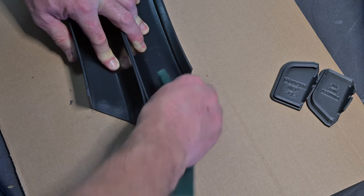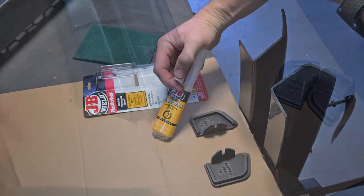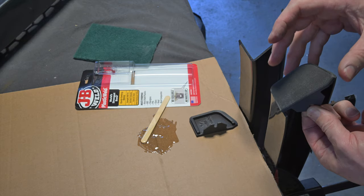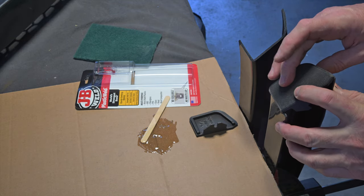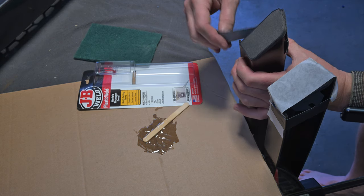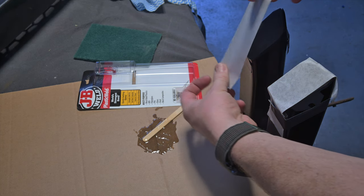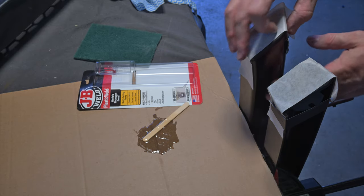Remove the flare and clamp the template into place then carefully cut along the line using a hacksaw. Remove the tape and the template then scuff the inside of the flare along the cut. You can then mix up some JB Weld plastic weld epoxy and glue the end caps to the flares. Put some tape over the caps to hold them into place until the glue dries — it's best to leave them for 24 hours for maximum strength. Ordinarily you'd then fill and tidy up the cap join then prime and paint the flares, but I won't be doing that until I cut and cap the rear flares with the rear bar installation.